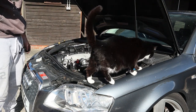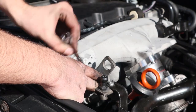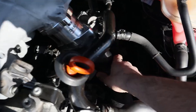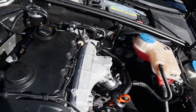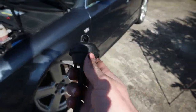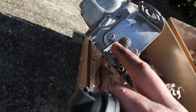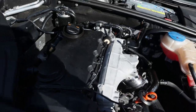I think it's time to give the car a decap. I think we're done - everything is back where it needs to be. All the EGR bolts are tight, the hose is back in, and the manifold is nice and tight. One important thing to mention: you have to plug this vacuum line that ran to the actuator over here. This actuator received vacuum and opened and closed the valves on the swirl flap mechanism. I'll go get some clamps to tighten things up, and then we'll start it and make sure everything's okay.